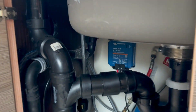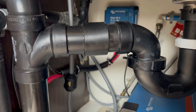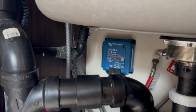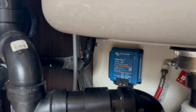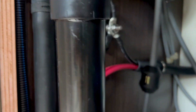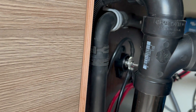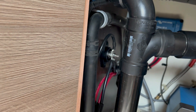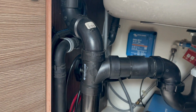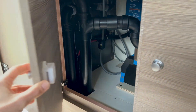Back here is our Orion XS — this is a 50-amp DC-DC charger. At this time there's only a non-isolated version available. The isolated versions of the original Orion are nice for a truck camper situation, so what I did was add a bus bar for our negatives. We have our negative coming off the truck connection, off the DC-DC charger, and then a line going back to our distributor.